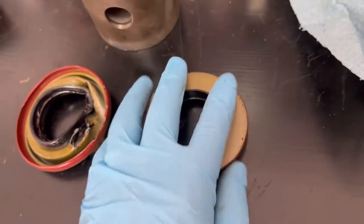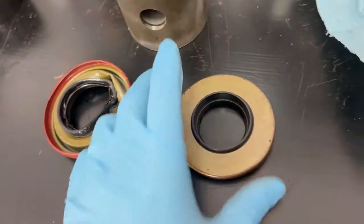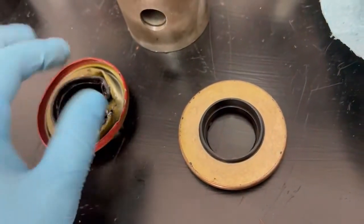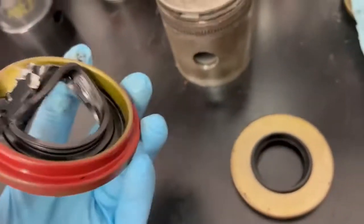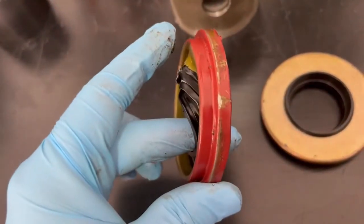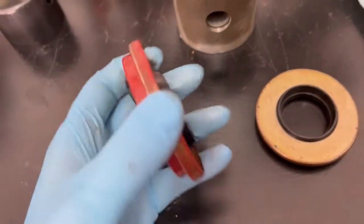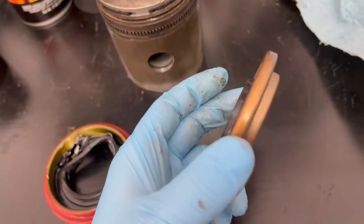I popped the old ones out — as you can see, I had to kind of rip them out — put the new ones in place, and everything's smooth. Now the pinion is riding perfectly, no issues. So I don't know, maybe I installed the first ones wrong. Maybe there's something I missed. I don't want to talk poorly about those seals, but maybe someone can comment below. They did not work for me, and I went with these off of eBay and they worked great.